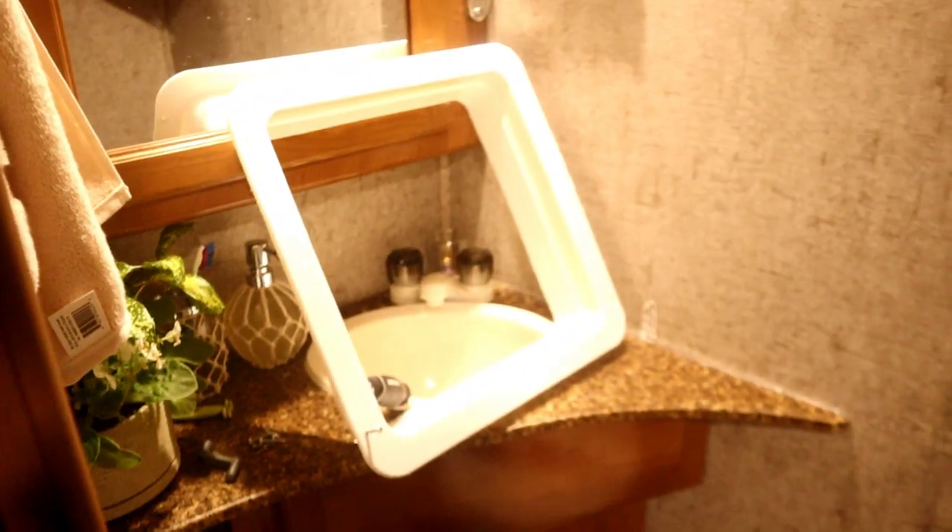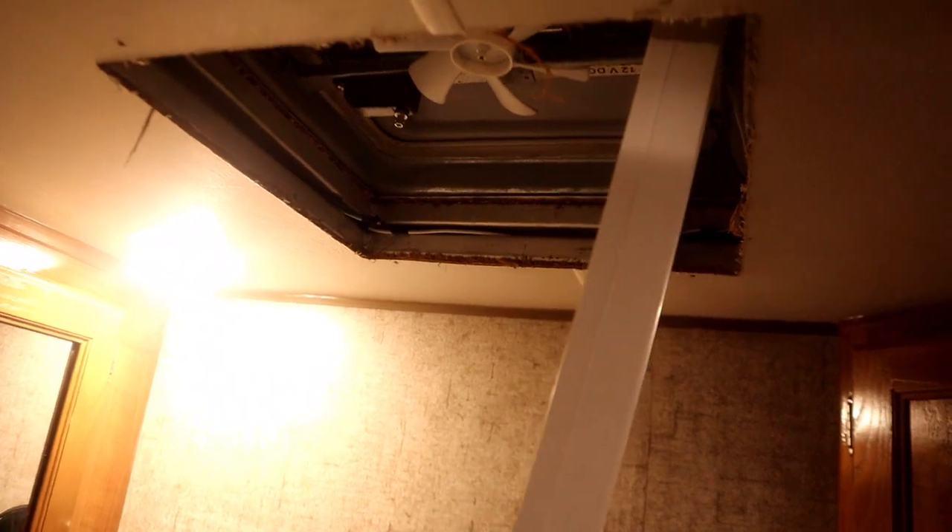I was like, what is going on? So I had to tear the vent apart — just the inside, I pulled it apart to see where the leak was coming from. Luckily it wasn't coming from the seal or anything like that, but it was coming from the vent. The vent had dry rotted and cracked. And it's only a year old — still a 2018, which I consider new. But it does have 14,000 miles on it, so it is used.